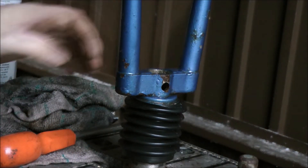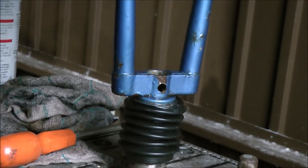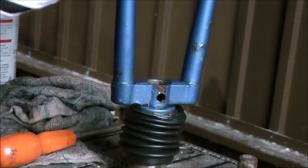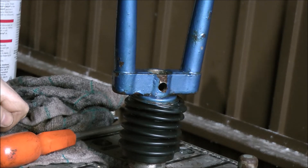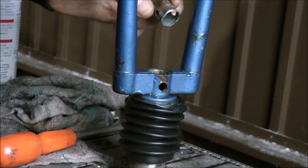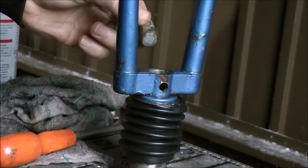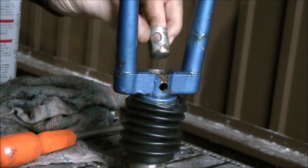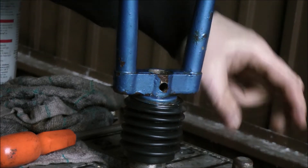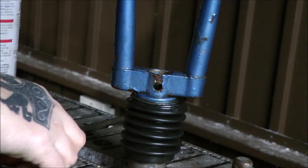Should be able to loosen it and free it from its little trap. Listen to that crunch — that's all the rust inside on the spring and on the inner of the tube. That probably explains why I wasn't getting much suspension on the front. I think whoever's been in it before might not have got this far, because they might not have been able to get this tube out — it took a bit of doing. But that sort of pre-tensions the rubber spring in there, although where it is now it seems stuck, not wanting to come out which would be its natural escape route.